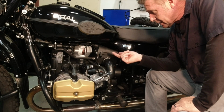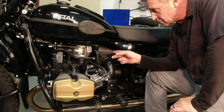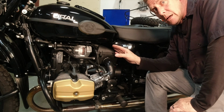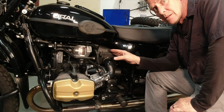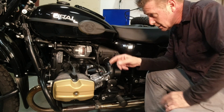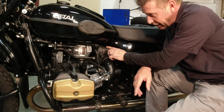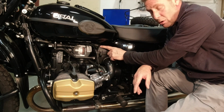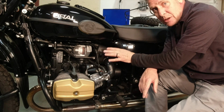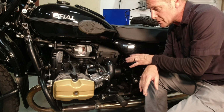And although I mentioned it in the other video, which I strongly encourage you to go watch, I do want to mention that as far as retrofitability, the old style metal airbox cannot be retrofitted with this new style. The reason is the gas tank mounts used to be down below, and it won't allow passage of the snorkel or the front of the box. So that is one of the changes we've made over the years that does not cross over between years.